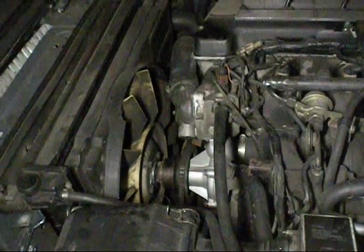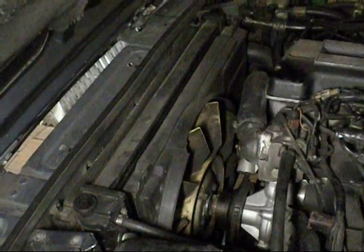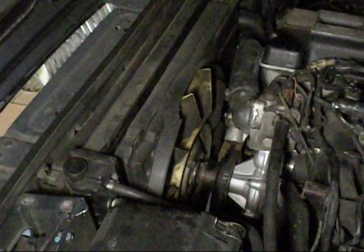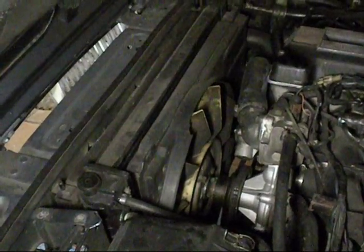The bottom hose was quite hot, but the fan is locked in. I've taken the radiator support panel off the top cover and found some interesting things there which would explain that. Well, that's just what I can see from the top, but I'm pretty sure the radiator has to come out.